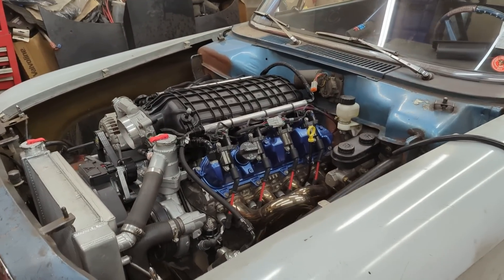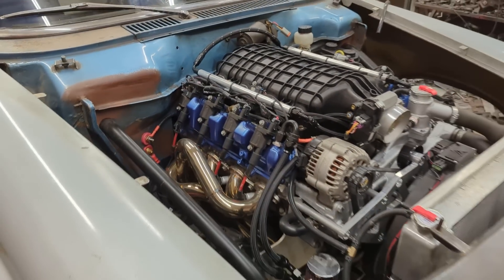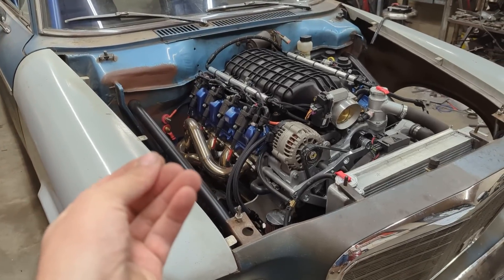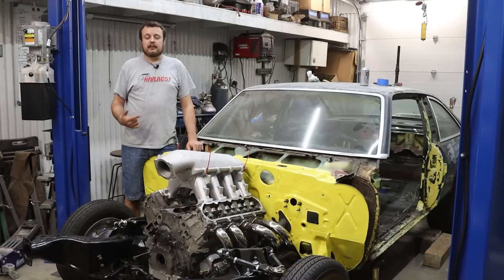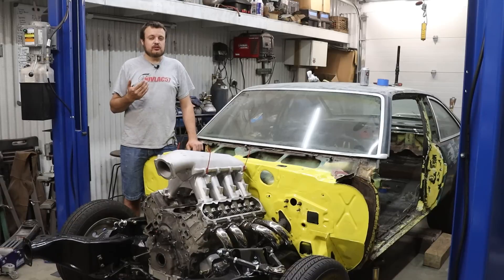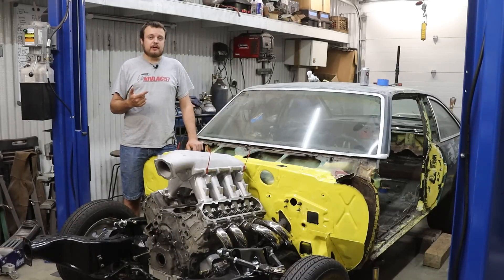These were a lot of work to produce. Today we're going to explore another possible method of making those pulses going into the collector as even as possible. To start this video off, I'm going to hand it over to my dad, who's been building headers for longer than I've been alive. He's going to show you his spreadsheet that he uses to determine how much power you can expect from an engine, which will determine the primary diameter, and then that primary diameter will determine the exhaust primary length.